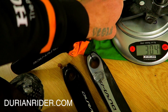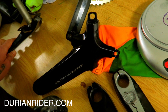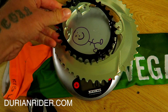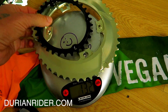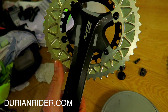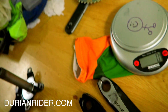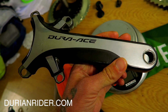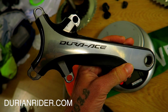So should you upgrade to the new Dura-Ace cranks? I mean, the black color sort of looks nice, but there's no need to — weight-wise, it's actually marginally heavier. But I'm going to put these chainrings on there — these super light Absolute Black 46/30. There's only about 50 grams difference in the 105 right-hand crank versus the Dura-Ace. Whatever you've got on your bike, as long as it's the right length for you, it's good enough. Weight doesn't really matter that much with Dura-Ace versus 105 — it's just the aesthetics you're buying.